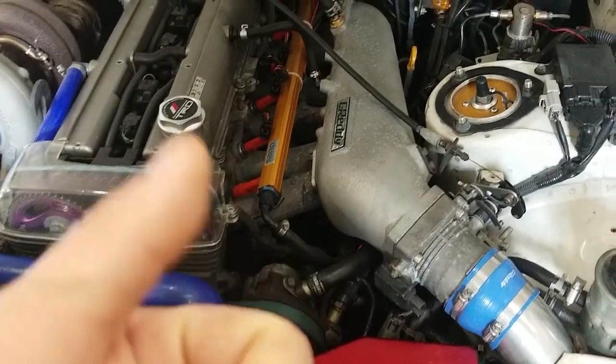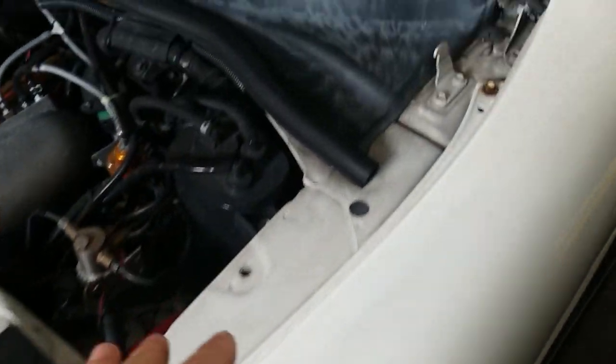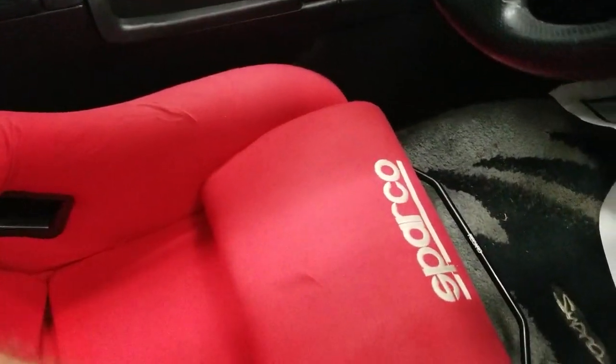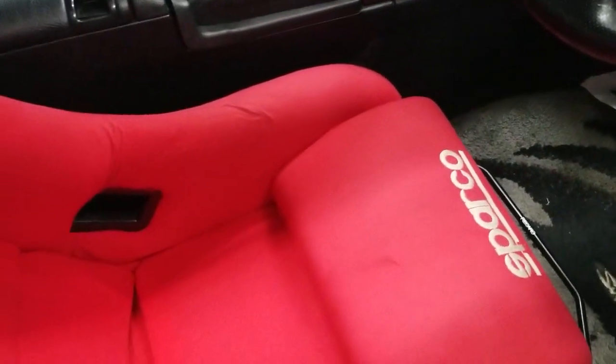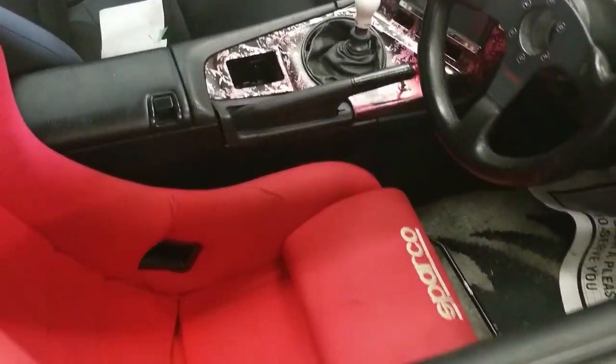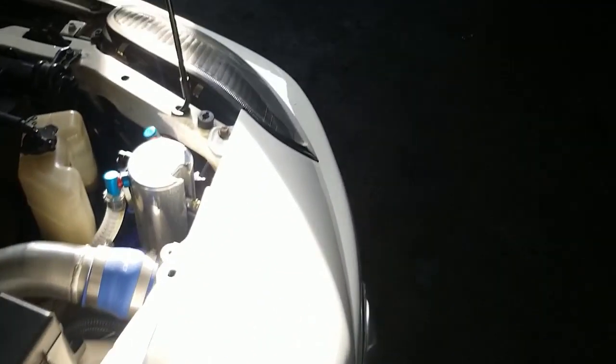Another problem that this car has with older technology, for a lot of you guys buying used parts, is that it has an HKS FCON, which doesn't have parameters for cold start, and it's also locked. It doesn't have parameters for cold start to adjust for the cams and everything. So what we do with the AEMs is we'll raise the idle to 1,000, and then we will also have a separate map for cold start and E85 start, et cetera.